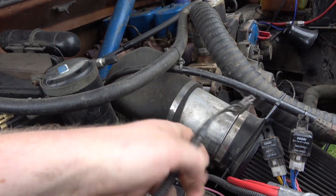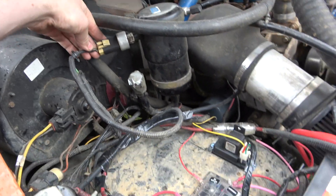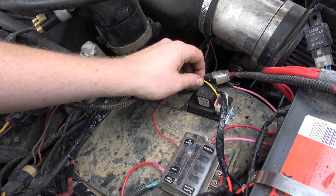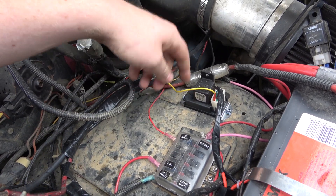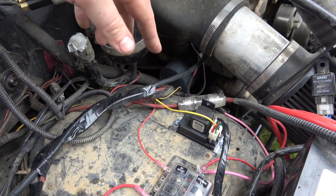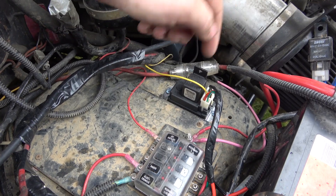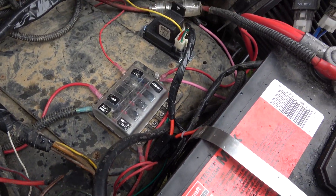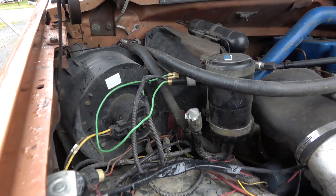So this is ready to plug in. For right now I'm going to jump this just so I can test the AC circuit - even though I just wrapped it all up. I'm going to jump that with a little jumper wire so we can force the AC on, even though there's nothing here. We're just going to do key-on, engine off. This will be our key-on, and then the green which is hooked to the green wire - that's the AC override. We should be good to go. Let me jump that real quick and then we'll do key-on and put it in AC mode and see if this works.